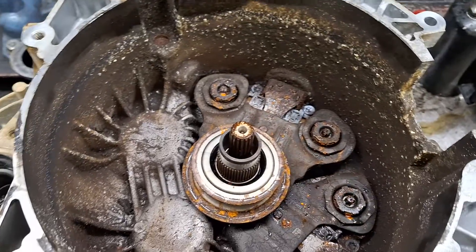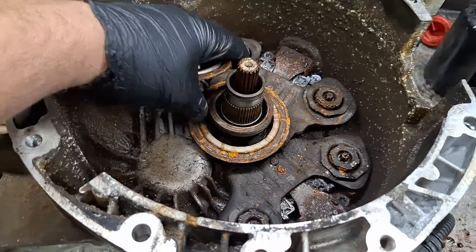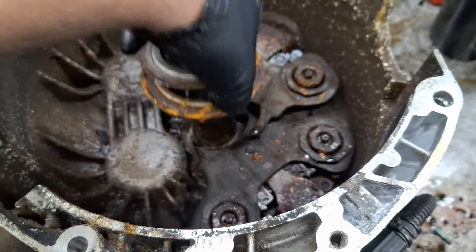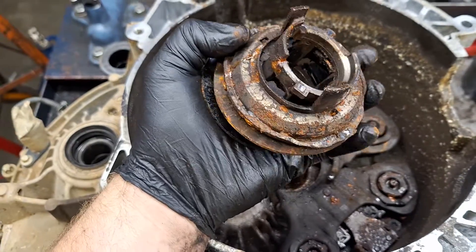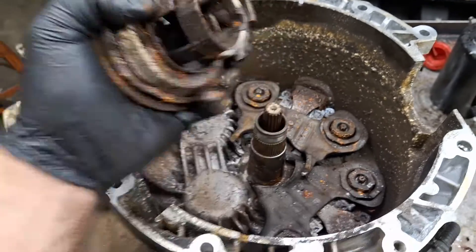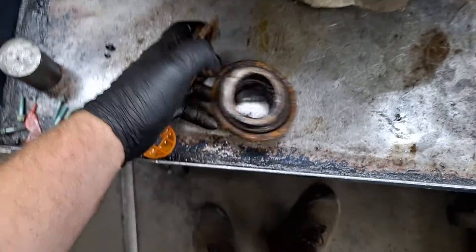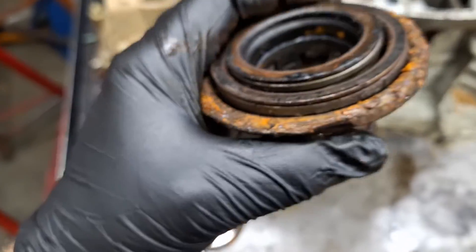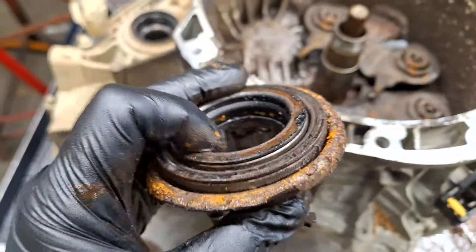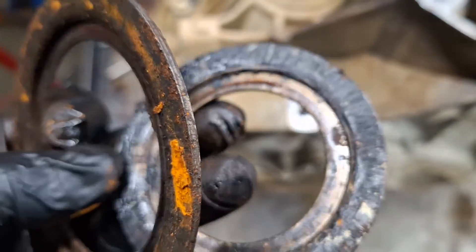Look at the gap between the two Z washers. This clutch is stuck applied up here I think — yeah, it's not supposed to be that high. I think the fork's stuck. Yeah, it's the fork. All that gummy varnish on there from the water. The bearings actually feel okay, believe it or not. Obviously I wouldn't reuse this ugly thing, but it actually is functional at the moment. Z washers — now there's evidence of blue grease leaking out on it, so it's no good.